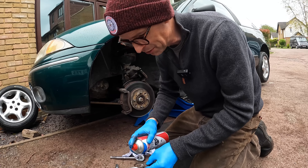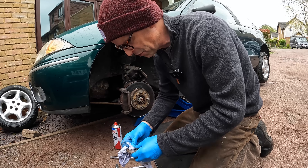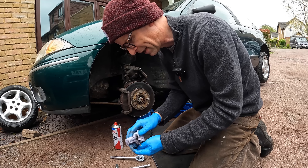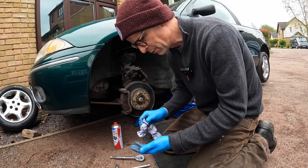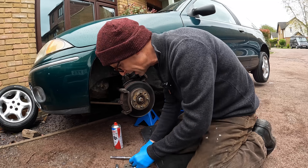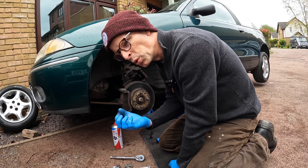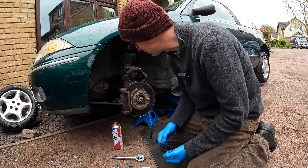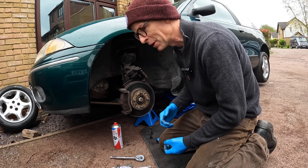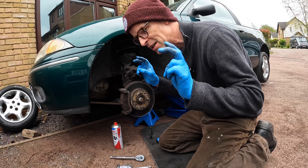While I'm here doing this on the 200 VI, behind the camera is Hippo the Freelander, which I took out on Monday with Furious Junior and Mrs. Furious for a family day out. Hippo has proved himself time and time again, but something started going grindy in the brakes - I'm hoping it's either something caught in one of the brakes or a frozen caliper, a bit like this one, because it's getting worse and worse as it gets hotter. It got worse as the car sped up so I'm pretty sure it's brakes.